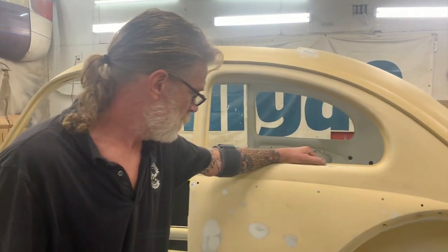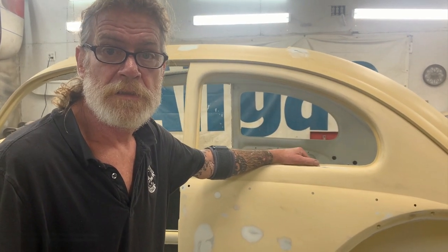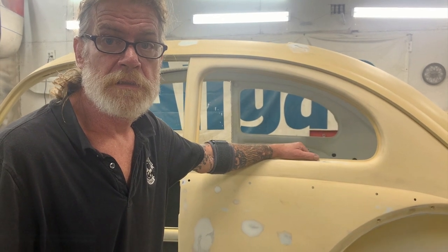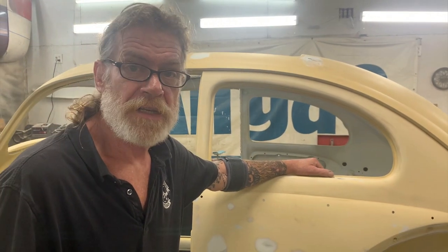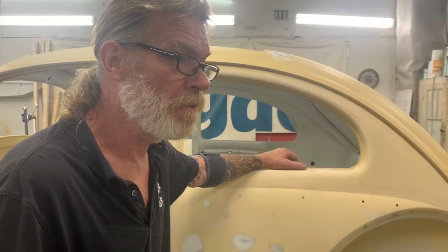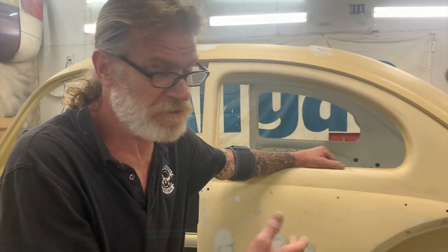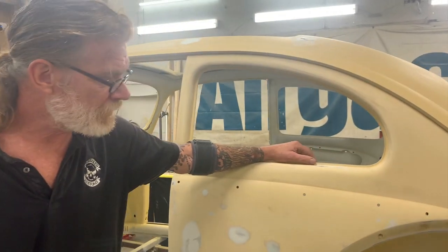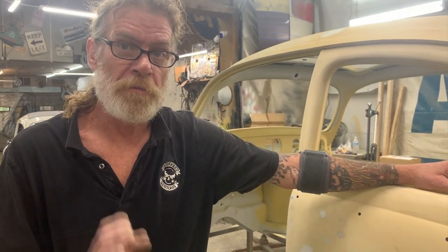Another week or two. Well, I wanted to see, because you're long blocking, and I want to give the nice people out there some tips. This is the secret to getting that dead nut straight paint job. This is actually the backbone of a really nice paint job. I will be teaching him how to pull the trigger, but it's fairly easy to do. It becomes muscle memory after a while. But if you don't get this right, it shows up later. And the darker the car, the more you're going to see it. Black is almost like a full mirror.